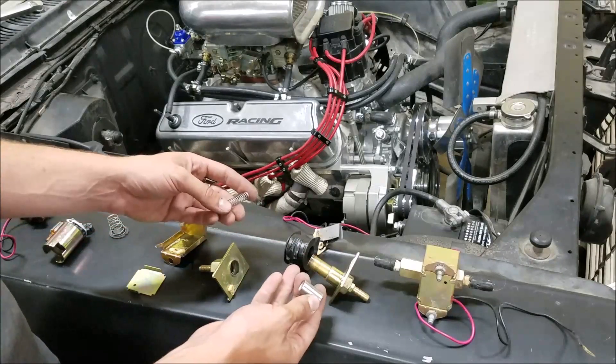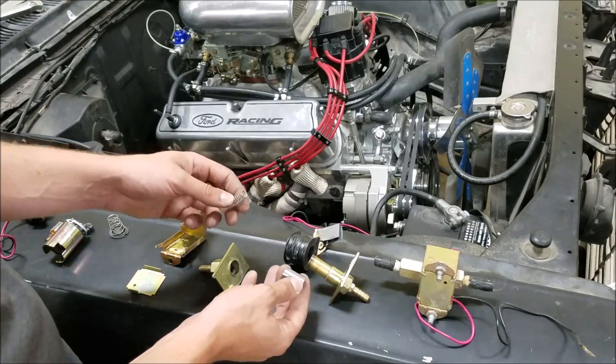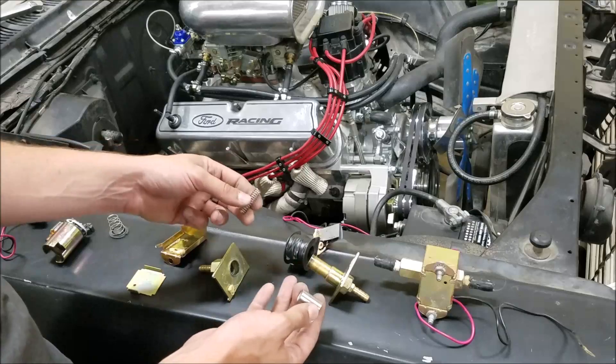It clicks back and forth continually. When you reach a certain point where your fuel pressure is up to 5 or 6 psi or so, you're overcoming this spring. That's kind of how it's regulated internally, and it won't blow up in your needle and seat. Once you have enough pressure to overcome the spring, you're not going to be flowing anything anymore.